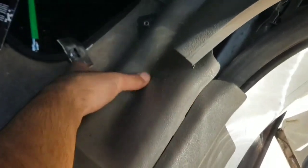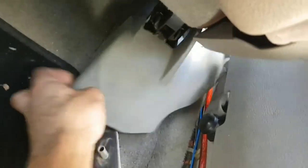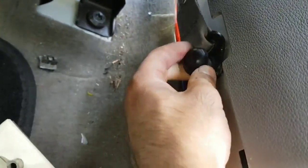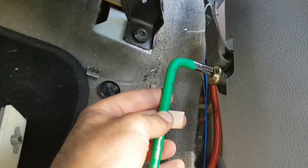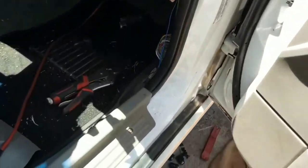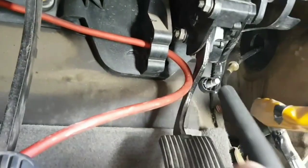There's a little side trim piece and a trim piece for the back half of the actual seat that just clips and slides out. For the seat belt itself, the tail end is bolted to the body of the car — there's a little plastic cap. Get yourself a size T50 Torx removal tool to unbolt the base of the seat belt. With that done, you can remove the kick panel, giving you access to remove and replace your broken bonnet release.